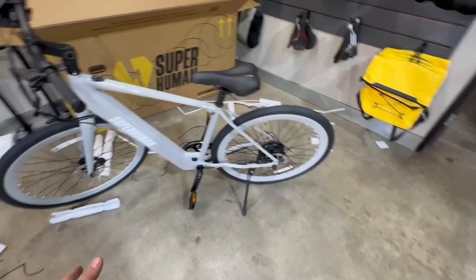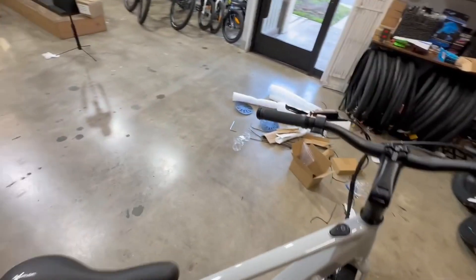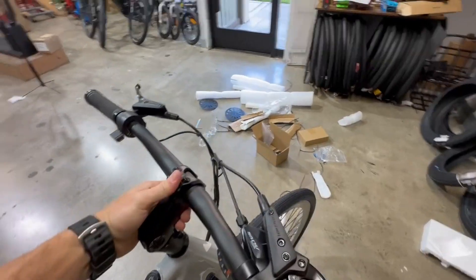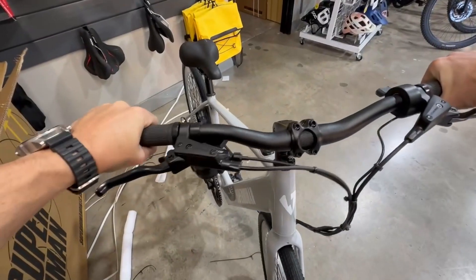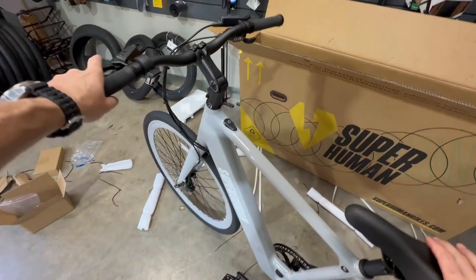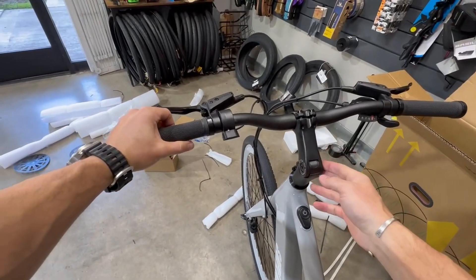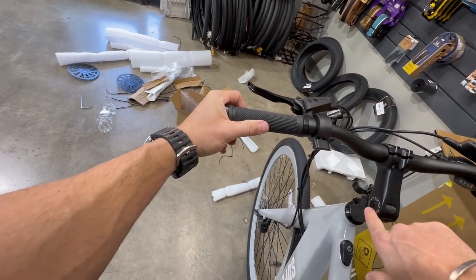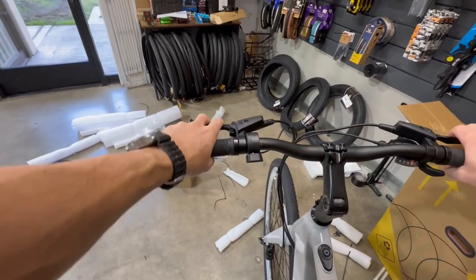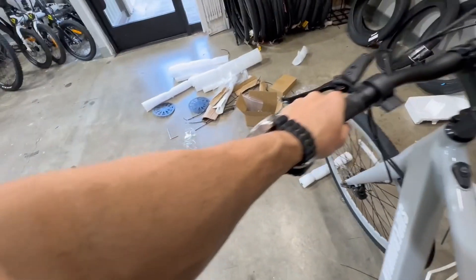So this bike is pretty much ready to go. Before we take off though, we want to give it a once over and make sure we've done a good job assembling it — there wasn't too much to it, about 20 minutes while filming a video. I'm holding both brakes here, giving it a test, making sure those brakes are really firm. I'm looking and inspecting — handlebars are solid, no loose screws. If you want to adjust the handlebars to suit your liking, you can loosen these on both sides — one here, one here — and they will go up or down. You can also move these brakes to fit your liking.